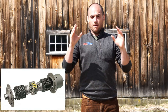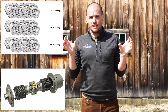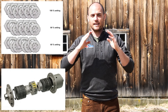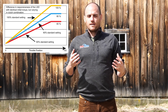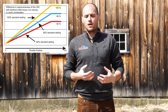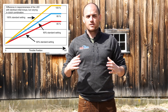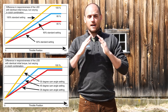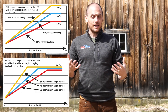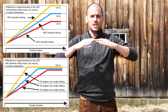That's where the clutches come into play. The ramp angle starts pushing out, but the amount of clutches on either side dictates how much the diff actually locks. Stack those clutches up and you can get a diff to lock completely; run fewer clutches and the diff will never fully lock at all. For a rear-wheel drive car going drifting, you want those tires to lock up hard and quickly — use a decent amount of clutches and a quick ramp angle. For autocrossing a front-wheel drive car, you might never want it to lock completely — fewer clutches and a shallower ramp angle.